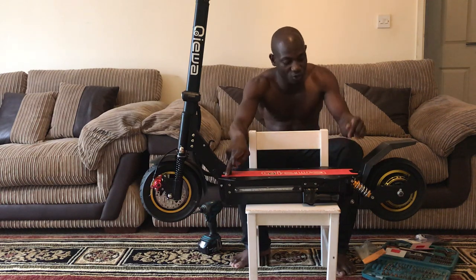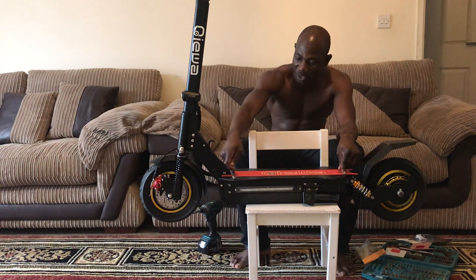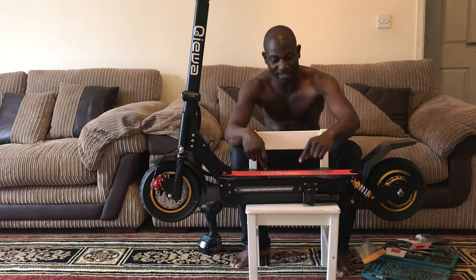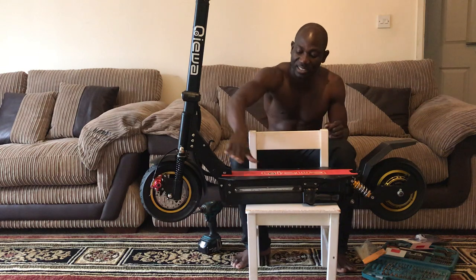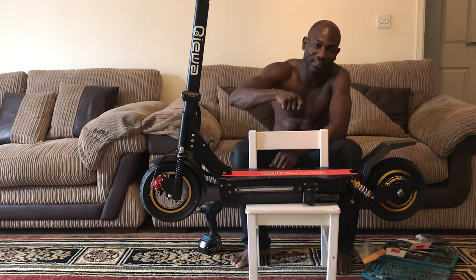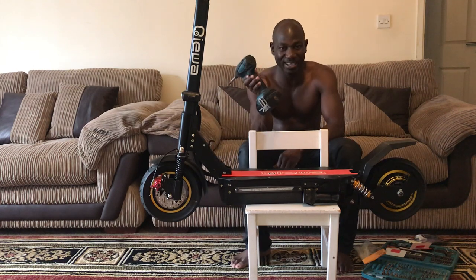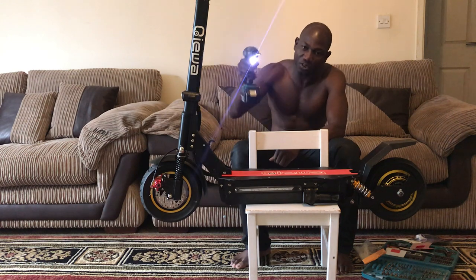You put one here, you put one here. You come back, you put one here, you put one here. You come to the first one, one here, one here. You come to the back one, one here, one here. You do it like that, so the pressure is applied evenly. And when you're doing that, don't go with a full spin. If you're using a tool like this, a cordless one, don't go with full speed, you go just small.